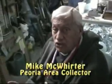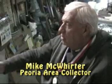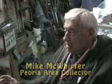Most of the early Wizards — the majority — were called H models. Then they went to the J motor, which was a little better motor. Then a 300, a 500, 300S, 600S, and 700 — 700 being the last one. They had electrics on them, lighting kits and generators. Then they went to the MS models, or the ones with the kickstarters — the later, more expensive, nicer bikes with a little more horsepower. All the bigger motors had German roller cranks in them.